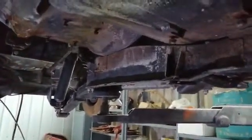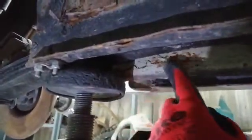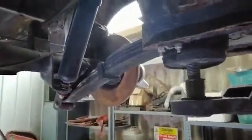If you've watched any of our earlier videos, you'll remember that there were some corrosion areas where the leaf springs sit in the body. The leaf springs are effectively an inverted leaf spring design that's fixed at this end, cantilevers in the middle, and then the suspension loads are on the other end of the spring.